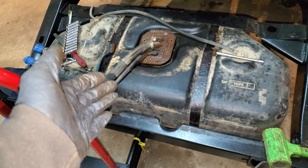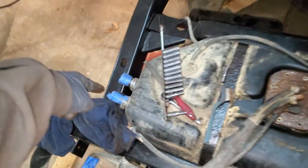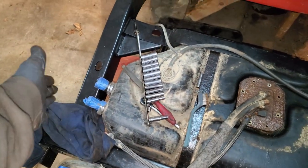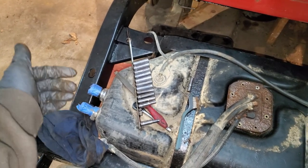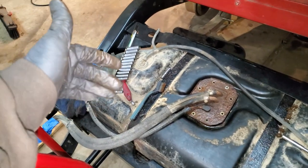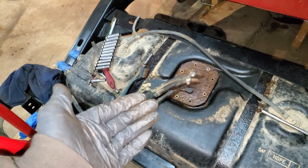The rumor is that they're the same tank, and that this hose right here is the breather of sorts. This is what sends fluid back up when you're refueling to tell the pump to stop pumping. Rumor has it this hose has a tube on the inside, and if you cut it shorter you can fill the tank fuller — and it becomes the high capacity tank.